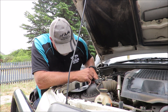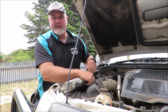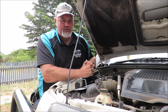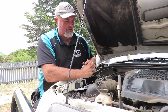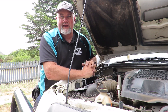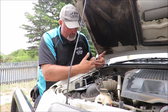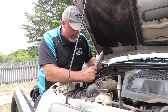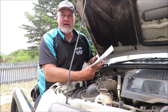I've set this to the wet cell battery setting, which matches the battery I've installed. The charging light is flashing, so it's currently charging off the solar panel — which is exactly what it's meant to be doing. I'm on a camping trip tomorrow for a week or so, then back for a couple of days, then on a tag-along tour for another week, so this will get a fair workout. I'll give it a few months, come back after the tag-along tour season, and let you know what I think. For now, I'm happy with it — it went in easily and appears to be doing what it should.